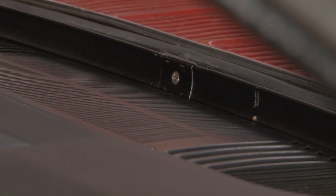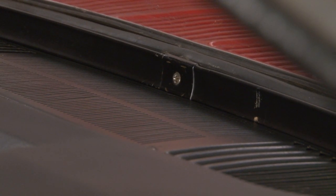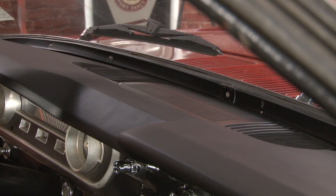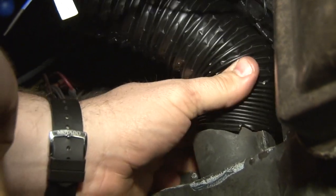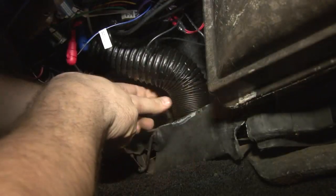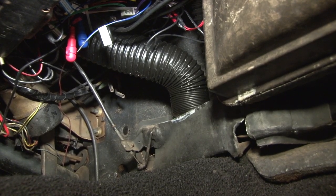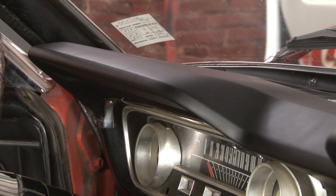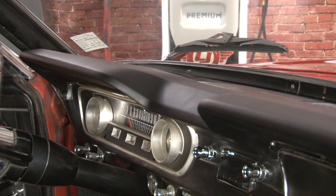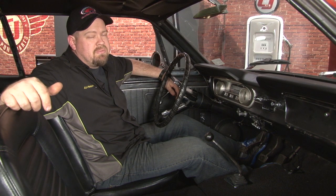And we're finished with our dash pad. Getting the screws into this dash pad is going to be probably one of the most time-consuming parts of the installation — getting the lineup just right can take a little bit of time, but if you use a pick to find the hole it'll make it a lot easier. Now for the last step, we're going to connect our new hoses. Once you fish them down under the dash, connect them to our plug. And our installation is finished. Even though the dash pad we removed from our weekend wrench wasn't really in bad shape, our Ford Tooling dash pad is still a huge improvement. If you have a typically damaged, warped dash pad in your 60s Mustang, it's going to be a night and day difference when you're finished. Figure installation is going to take you about an hour and a half to two hours — you'll be back on the road in no time.